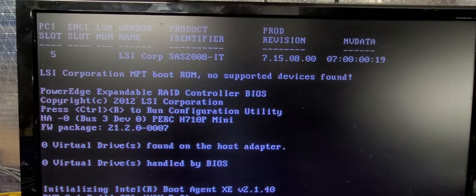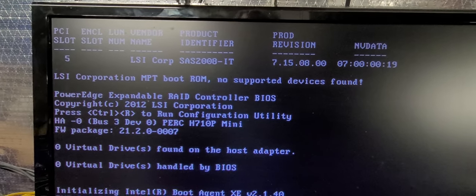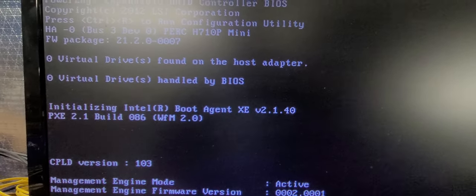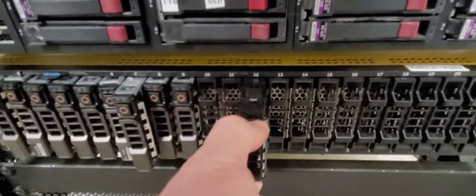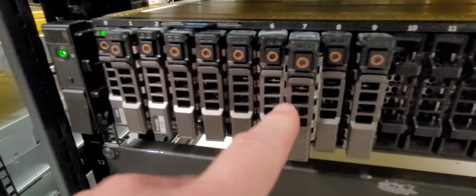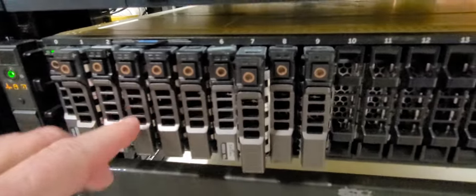And a caddy is just nothing but a blank. In other words, it either is a drive ready to mount caddy or it's a ventilation blank. And I have that here in this environment setup so that you can, here, I'll show you what it looks like while we wait for it to finish posting. Now these are blanks right here and they're just basically plastic. They have no value except for the fact that they balance airflow through these slots. These are drive readies. In other words, they're ready to mount a drive, but when you put them in like this, they also balance airflow. So make sure that you do that. All right, so